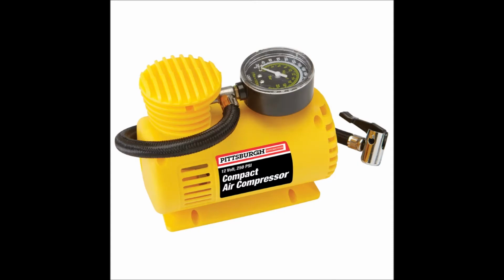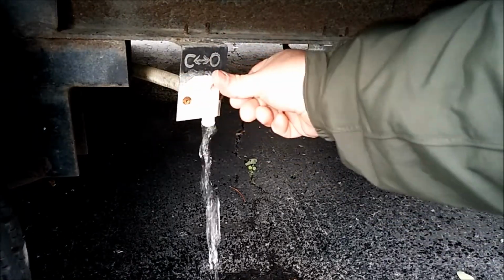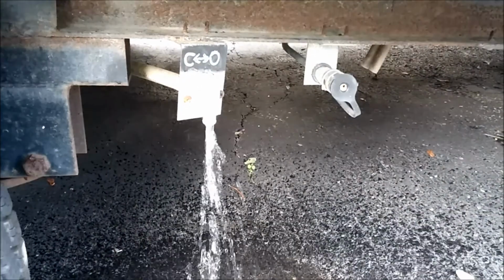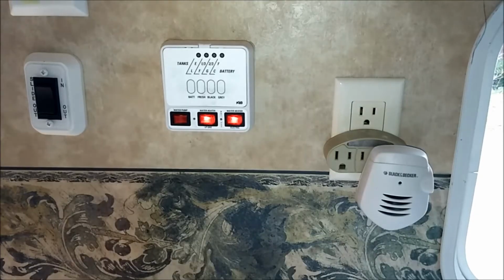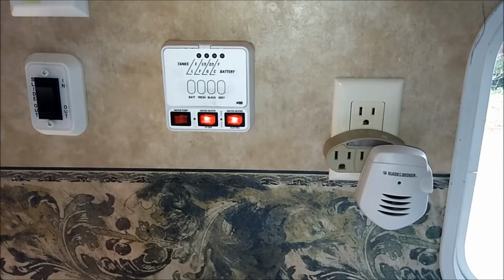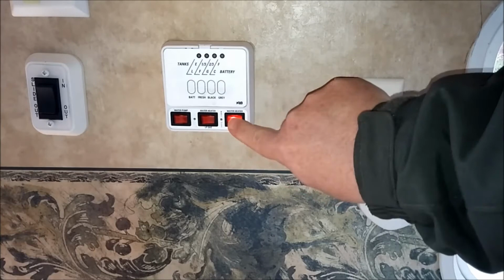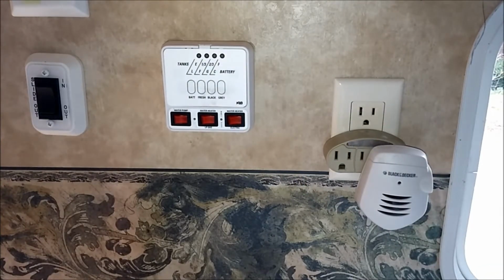The first thing I'm going to do is release my fresh water tank. I know that my fresh water will drain by gravity back from the water pump into the tank and then out through the spigot, so this is all I will need to do up to the antifreeze injector. Back inside, make absolutely sure that both your propane and electric hot water heaters are powered down. Heating an empty tank will destroy it, so it must be off before draining the plumbing any further. Your heater may have an external lockout, mine does not.